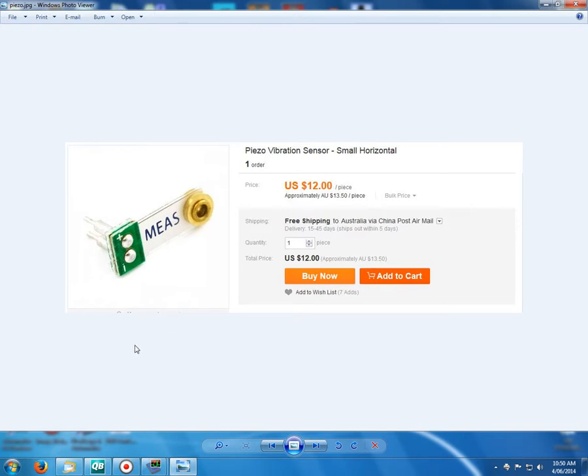I had a Toyota Celica come in. It came in for a drivability complaint, which turned out to be some leaking electrolytic capacitors on the PCM board. That was resolved, but while it was here, the customer asked me about a vibration that it had. It's a 2.2 litre Celica with an automatic in it.